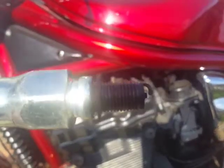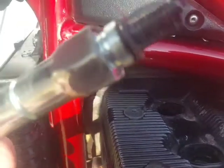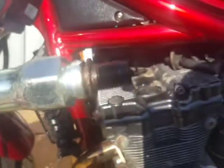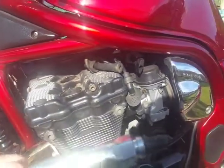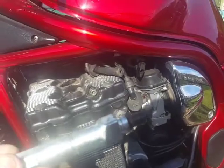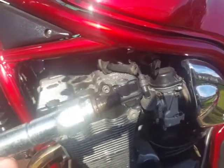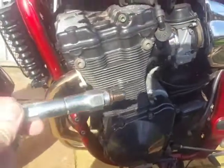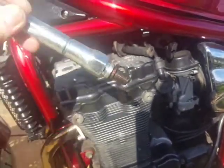The plug's a decent colour. Don't worry about the oil around the thread — that is actually anti-seize. I'm going to take all four of those out, pop them into the leads, and then figure out a way of earthing all of these to the engine somewhere. The engine's probably best because it's used to being in the engine.